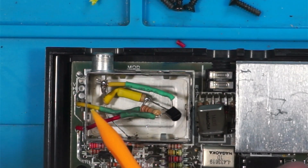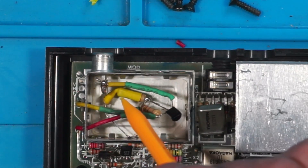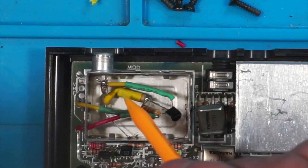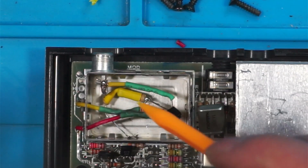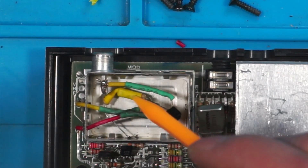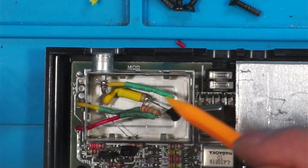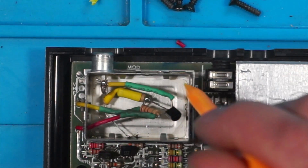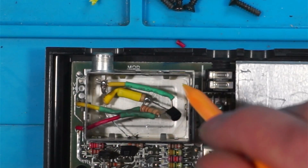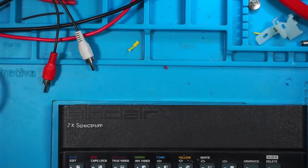This has been a success but a bit of a pain. I would do the same thing again, but this resistor that has to go to ground — if I'd bent it backwards and brought it out the back that would have sat much easier. Next time I would just bend that one back, the whole thing would lie flat, and I could have tacked the ground under the back of the shield instead of going awkwardly underneath.